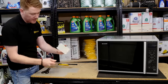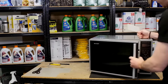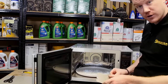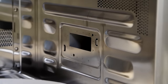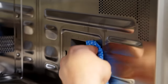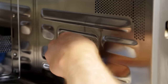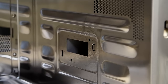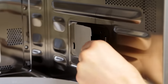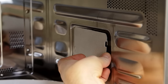Once you're happy with the waveguide cover, simply pop it back into the microwave — you may have to give it a little bit of flex to make sure it goes back into position correctly. Before putting it into place, it's a good idea to give the cavity a wipe down to make sure there's no food trapped behind the cover. Then simply slip it into place, using a little bit of flex to make sure it fits in correctly.